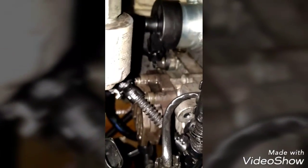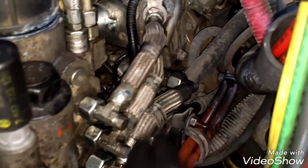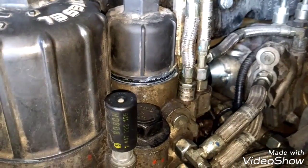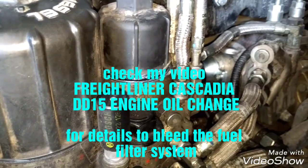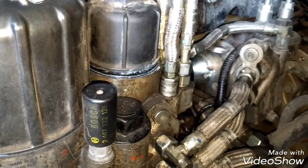We're going to insert the plugs — the fuel quantity plug and the sensor right here. The last thing to do is to install all the hoses we removed. Everything is back in place. We're going to double-check that everything is fine, and then we're going to bleed the fuel system. We're going to refill the fuel filter housing because we drained all the fuel.